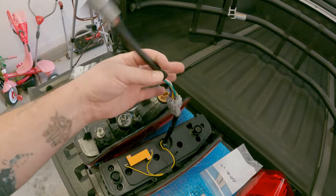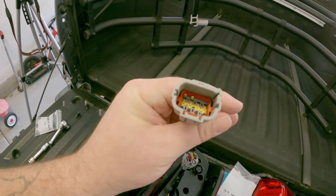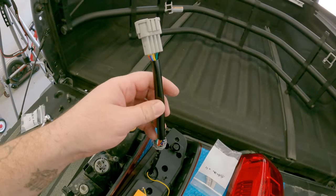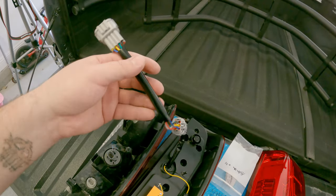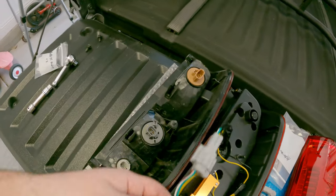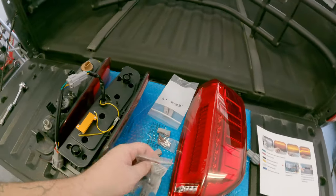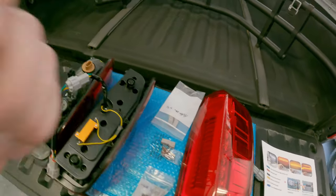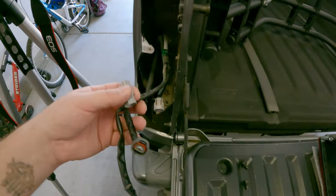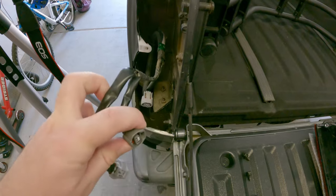The main issue is actually the wiring. The factory tail light has three clips, but the aftermarket has an eight-pin with only six pins populated, and then a six-pin clip as well. In the Amazon description they note two different wiring options - hopefully one of those lines up for the 2005 to 2014 Frontiers. Of course neither one of them is going to work for my Frontier, so I had to source new clips. There are two different versions - a two-pin and a three-pin.